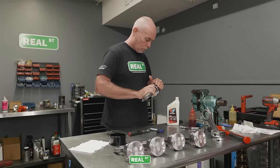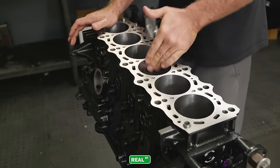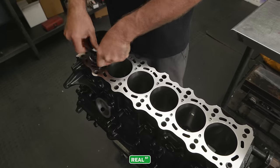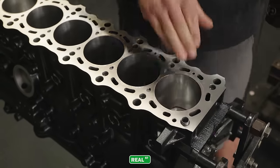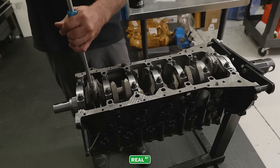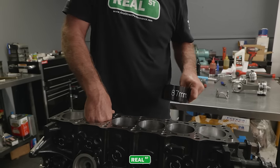Now I'm just going to go ahead and lubricate the piston skirts and the bores with 30-weight non-detergent motor oil, making sure there's lubrication present during startup. Depending on the bore finish and the ring style, some guys will use a thin lubricant like ATF on the bores, but motor oil is a safe bet — it's naturally going to be there when the engine is running. If you do run into an extended cranking period without oil pressure, it's better to have oil in different places than to let it be dry. I'm using a quality assembly lube from HPL and non-detergent motor oil on the bores.